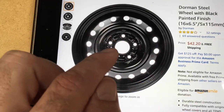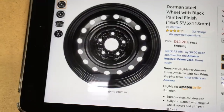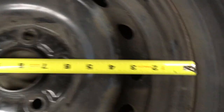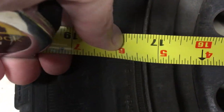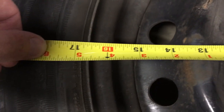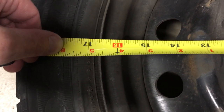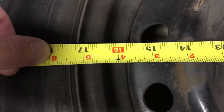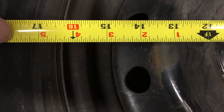I want to check that this is the correct wheel and double-check the figures. The 16-inch diameter is easy to verify — you can look on the tire sidewall where it says 205/55 R16, so we know this is a 16-inch rim. If you take a tape measure and measure from edge to edge it looks like about 17 and three-eighths, but you want the inside measurement. It's tricky to measure rims, so if you have the tire on, just go by the tire sidewall marking to avoid accidentally thinking it's a 17-inch rim.